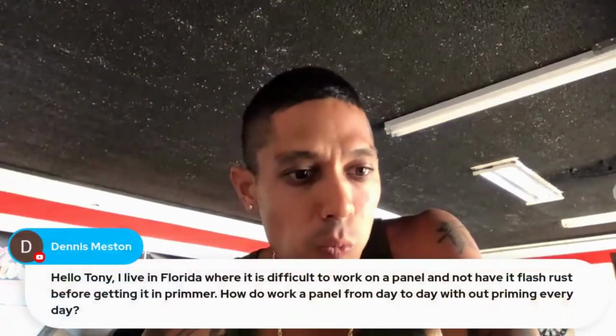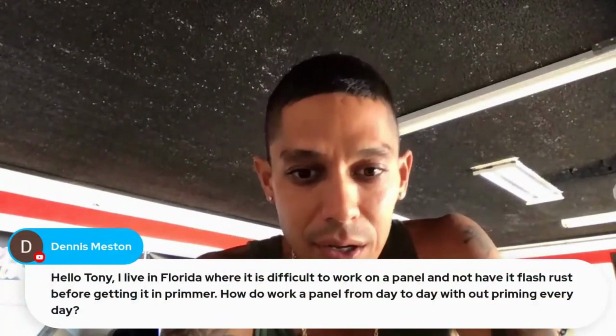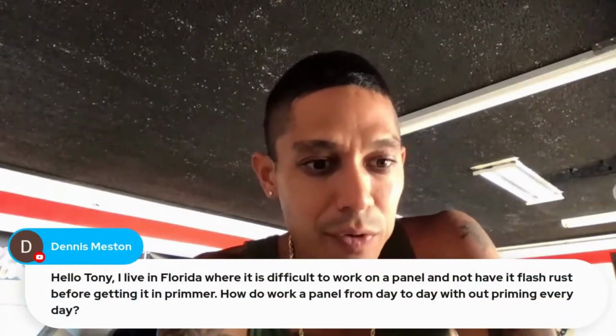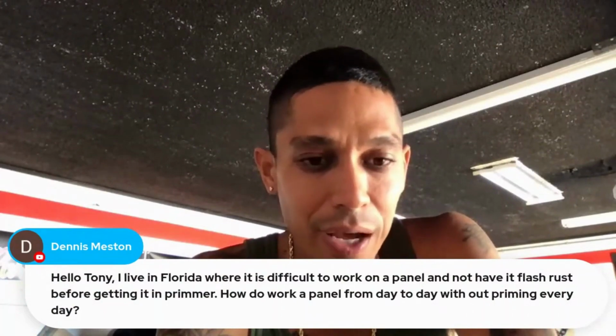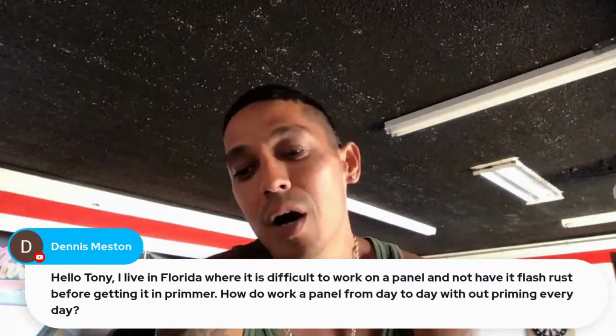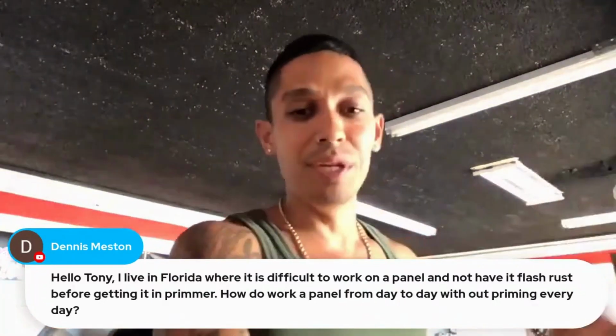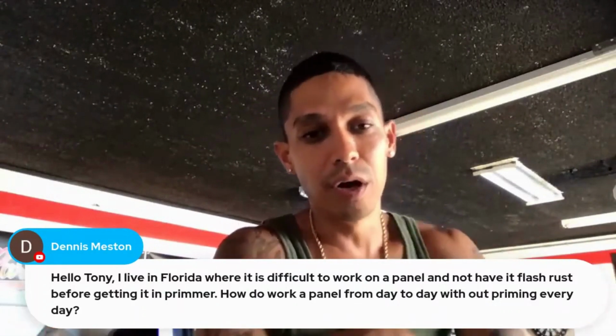Hey, Tony. Dennis says, hey, Tony, I live in Florida where it's difficult to work on a panel and not have it flash rust before getting in primer. How do I work on a panel from day to day without repriming every day? Well, you have a window where after you get something down to metal, you can just prime it that day. You're good. So I don't know what you mean.